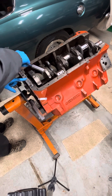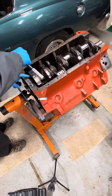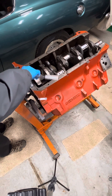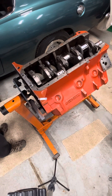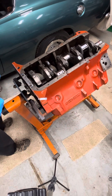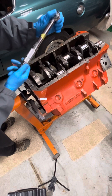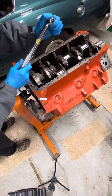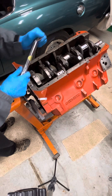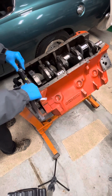Now this is aluminum — that's why it's a lot lower torque than those steel main caps that have much bigger fasteners. The torque is pretty much tied to the fastener style, not so much what you're fastening. You're working with aluminum and much smaller bolts. With the torque wrench — it's inch-pounds — we're going to start out a little bit lighter, probably like 240. I'll go a little bit by hand first.